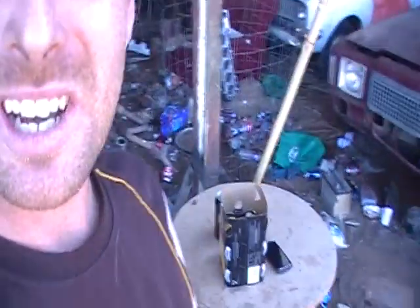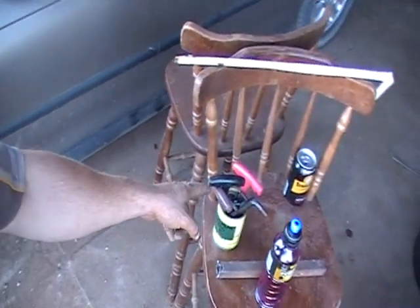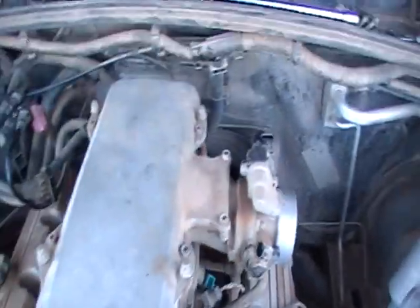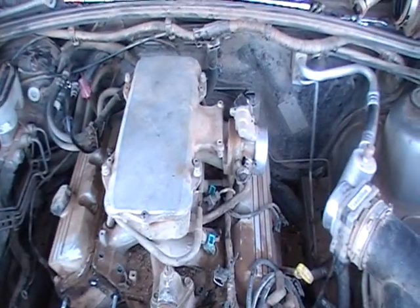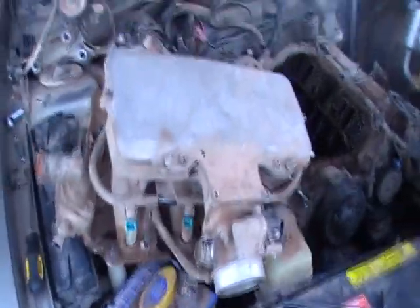Done the trip into Gladstone to get some Allen keys and more supplies — like a six-pack of rum. The Allen keys are there, but it turns out I didn't actually need them. We've now finished taking all the bolts out and the inlet manifold should just lift off — like so. And that's stage one. Now to work on the heads. Inlet manifold's off, just sitting to the side because I couldn't get the fuel lines disconnected from the back.